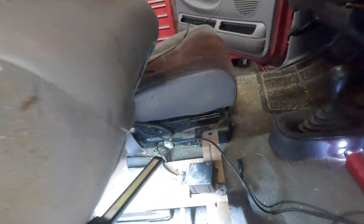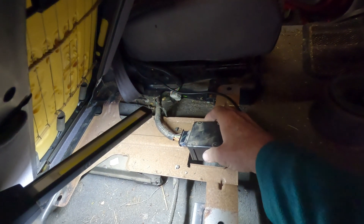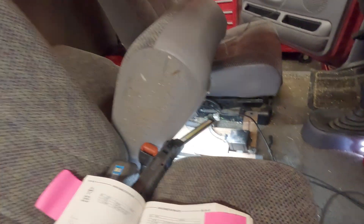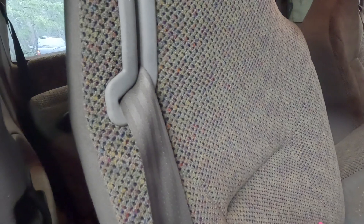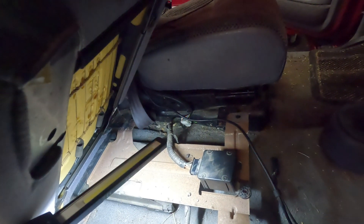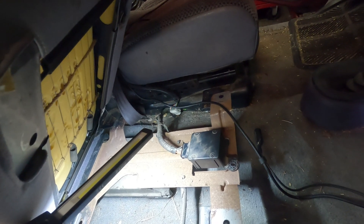I put it back together wondering if it might be a pin fitment issue — I put a little contact cleaner on the pins, cycled the key, and now look: it's working normally. This is either good news or bad news. The problem with an intermittent is it might fail again next week, but for now let's button it back together. We've shown that each solenoid draws about 250 milliamps, meaning that if you jumped it with unswitched power you'd end up with a dead battery within a couple of days.